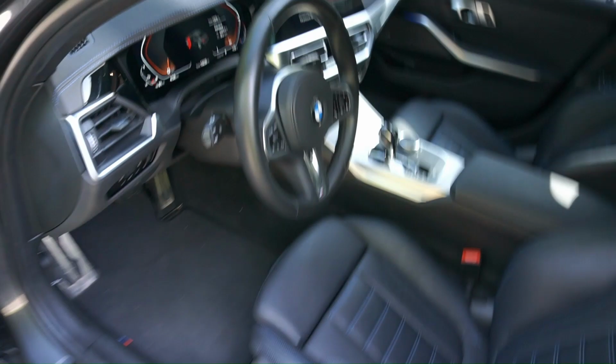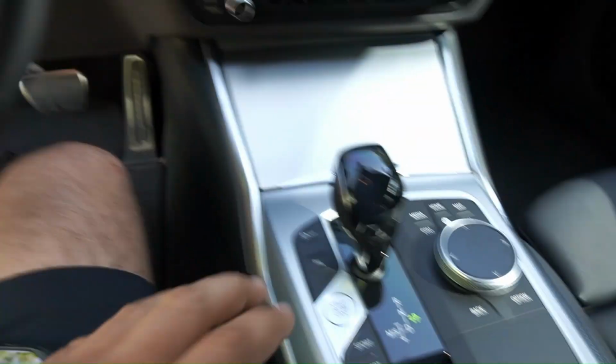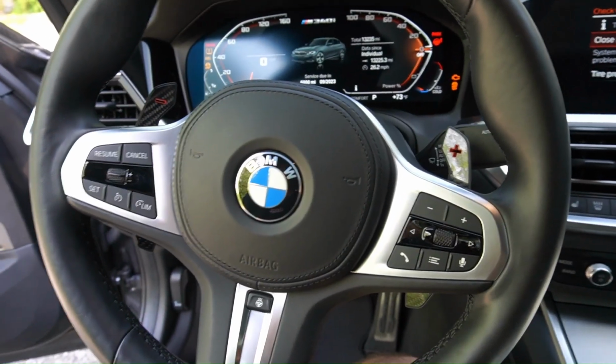Alright, with all that finished up, I'm gonna hop in the car over here. So now that we're in the car, the battery is connected. That's a pretty important step. You're gonna wanna make sure to put the car in diagnostic mode. How we do that is, don't put your foot on the brake and hit the start button 3 times. It's gonna basically turn ignition accessory on.